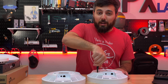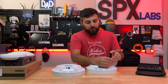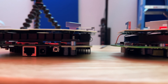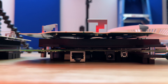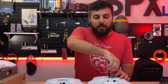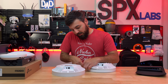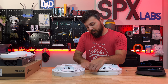To gain access to the internals there are a total of 5 screws that need to be removed, one hidden underneath a sticker as you can see here — so keep that in mind when taking this apart. If you don't like your stickers destroyed while disassembling a product you may not want to disassemble it, which is why I'm doing it for you since these are review units provided by TP-Link. Removing the shell is not incredibly difficult with the right tools, but it does require some finesse because there are clips holding everything in place.